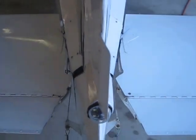So it's just part of the walk around — you're just making sure that there's nothing interfering. This is the trim mechanism here that works on both sides and moves both of those trim tabs. It's got a lot of elevator authority. Then we come back around this side, and that's the outside.